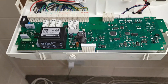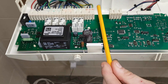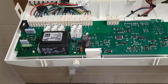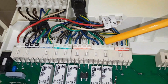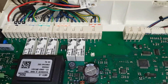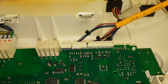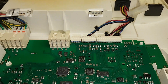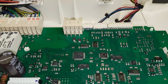The top PCB is for the boiler. Straightaway you'll be able to see a difference — the PCB is almost split in half. If I put my pencil there, the main difference is the voltage. On this side the cables are a lot thicker, so this is higher voltage. On the right-hand side the cables are a lot thinner, so this is lower voltage.